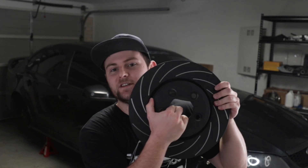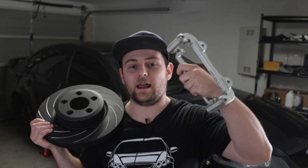The NA and the Turbo Falcons both use the same size calipers, the same size brake pads, and there is no difference between their master cylinders. The difference is that the turbo brakes use larger rotors and they have brackets to accommodate that extra girth. So the solution is to simply change out your brackets and rotors to the turbo ones, and that's it. You've got yourself turbo brakes, really cheap.